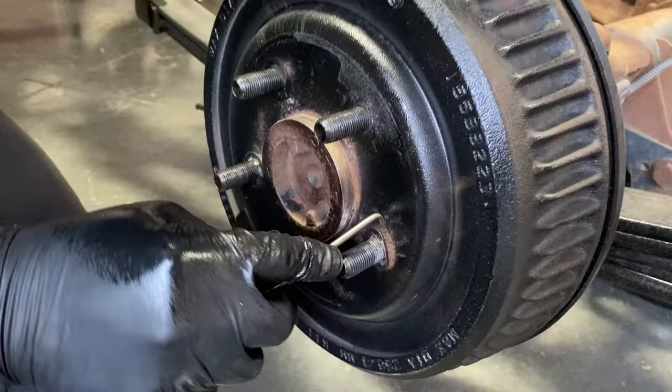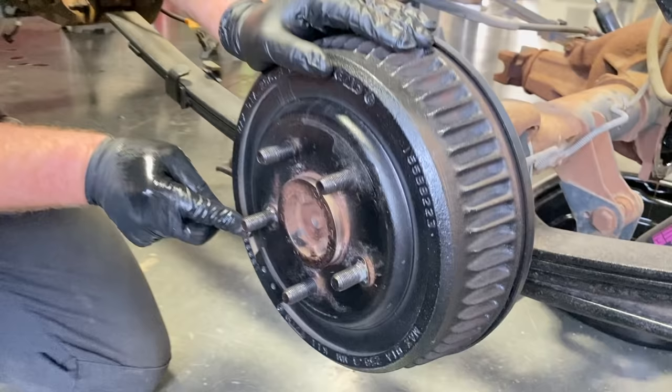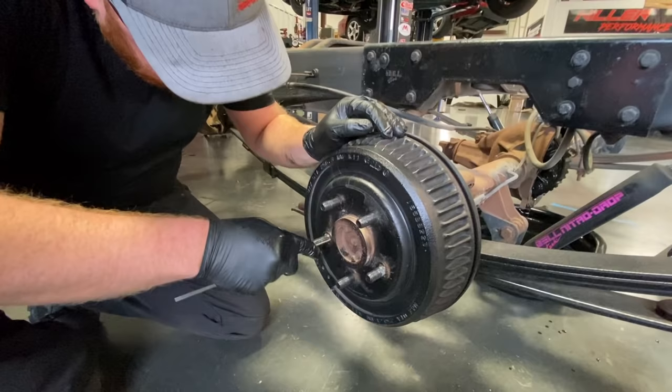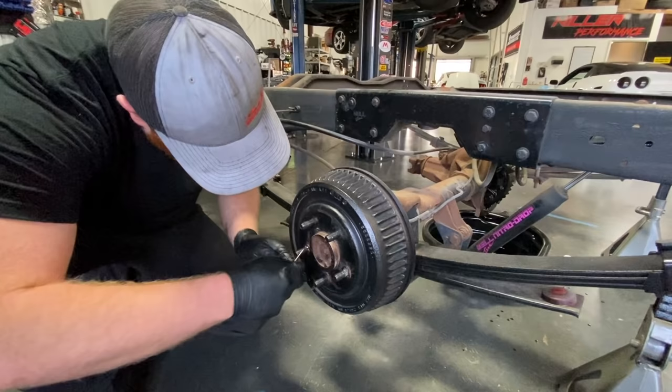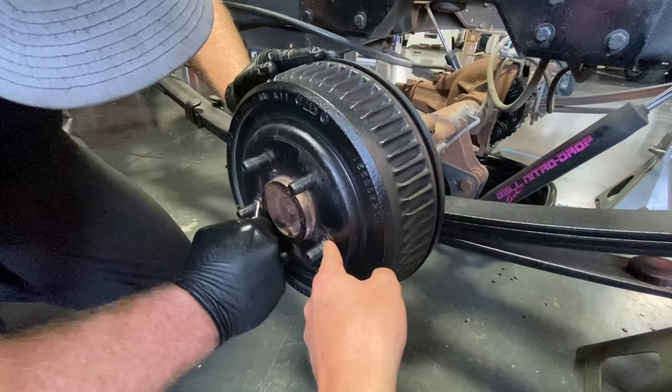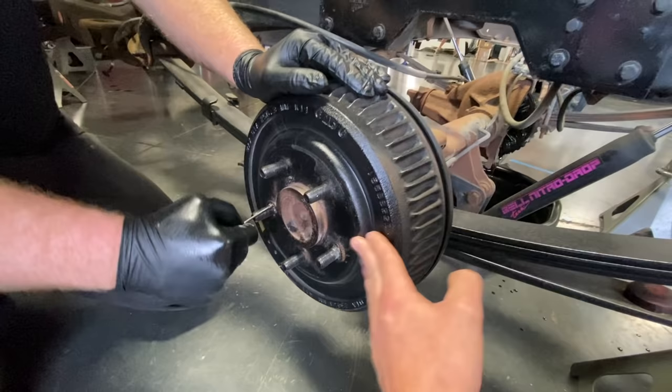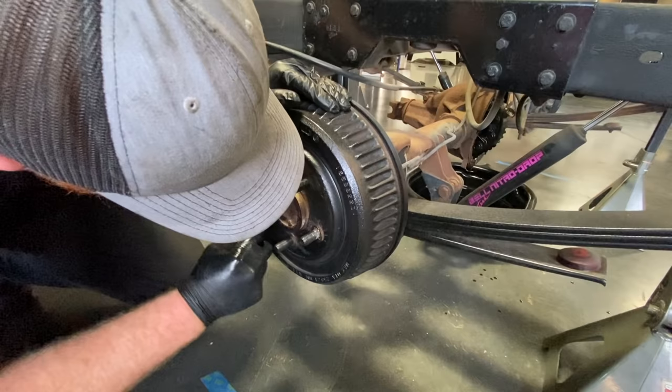So I still got the OEM retainers. Probably not, because I would not put these back on. I guarantee if they came into service about five years ago, they'd have gotten a clean and adjust on these bad boys. What we're saying is, with the retainers, when these things are going down the assembly line, they put these on there so the brake drums stay on the truck before they put wheels on. They basically go down on the stud and hold that brake drum on there. Well, they're still on there, so that means these things have never been off before. It's pretty cool.